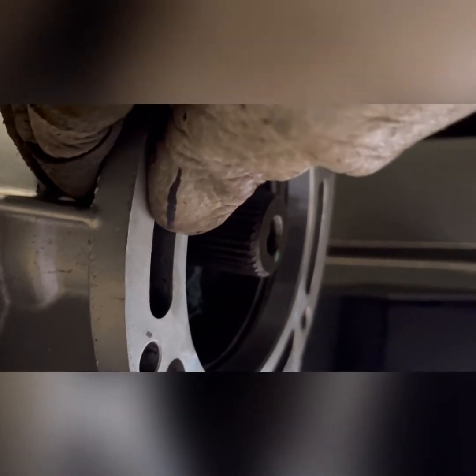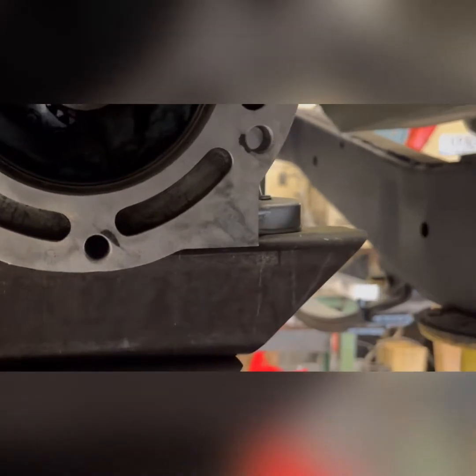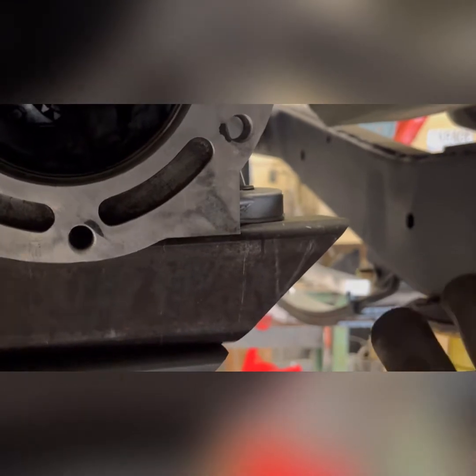This is the flange where the transfer case bolts to. So it's fairly small and it's only about a half inch thick. Then you take and you suspend the weight off to the side, either left drop or right drop, and you create a lot of torsional weight here. So in addition to a cross member, I also recommend taking some of that stress off of this flange by creating part of your cross member mount to hold the tail of the transfer case.